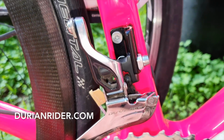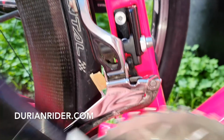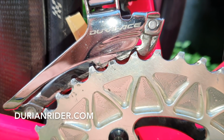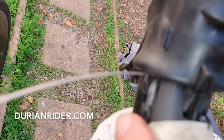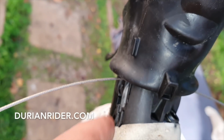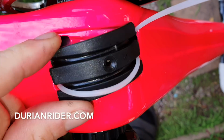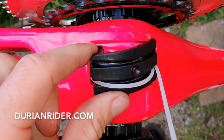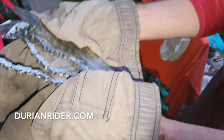Front derailleur is on. And remember, it's an oval chainring from Absolute Black, so it does fit a bit different. Get it dialed up. It's about a 2 mil gap. Dura-Ace ones, just peel the flap back like that, stick it through. There's a little plastic thing in there that you just undo, flip it off, and then push it through down there. And to make it even easier for the internal, just pop off this little cap here, and you can sort of faff around like that, and then boom, boom. So yeah, easy done. And a stash of Magic Cookie ampoules in there.